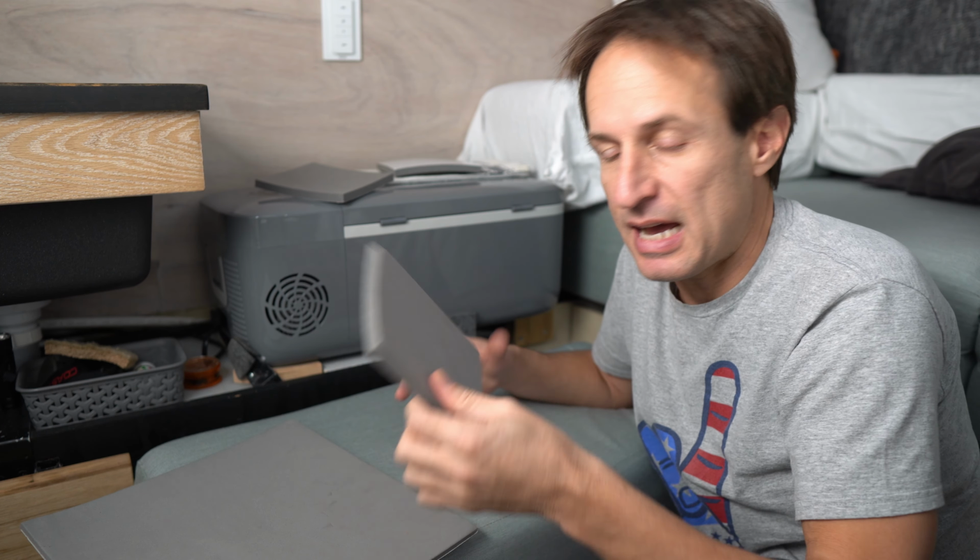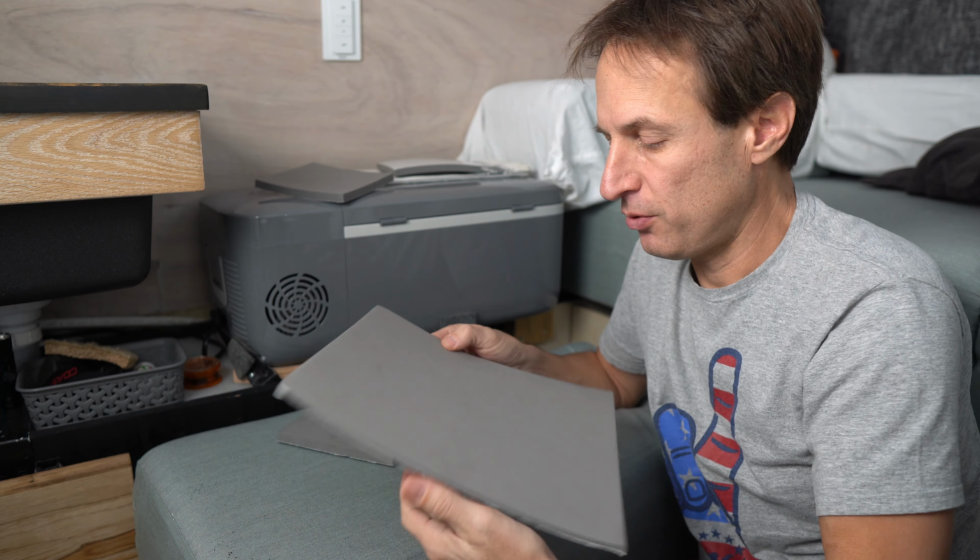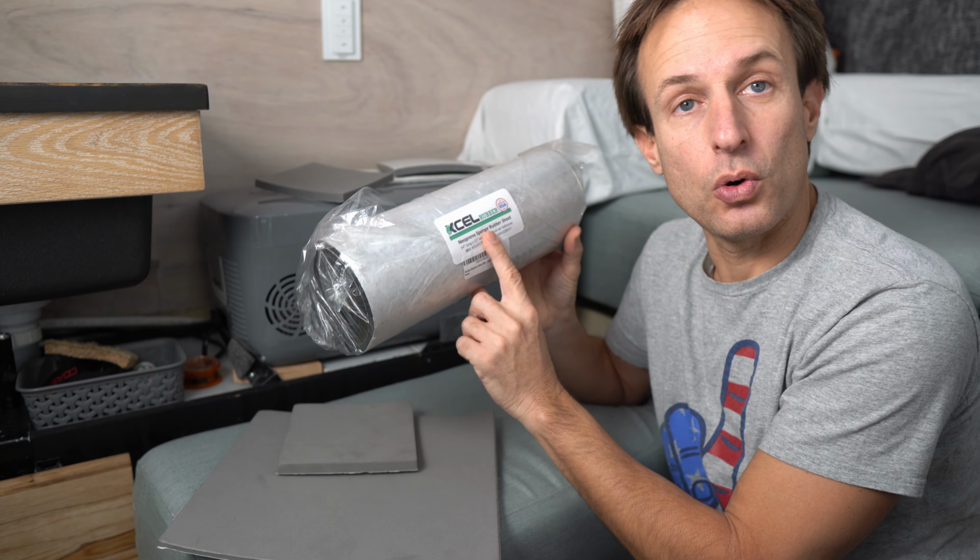Oxygen can't get here anymore. A complete vapor barrier. 1/2 inch, 1/4 inch. You are not gonna get condensation even on the 1/4 inch. This is 1/4 inch Frost King insulation. That is also neoprene rubber.